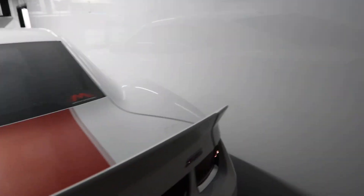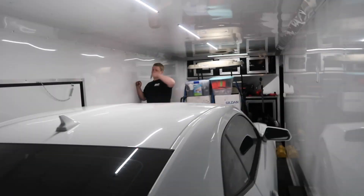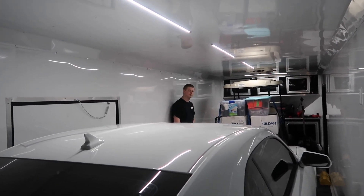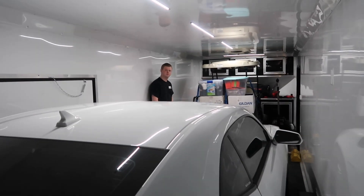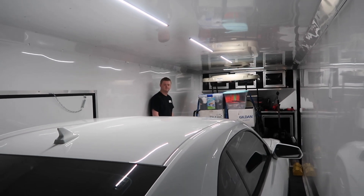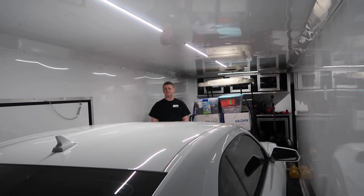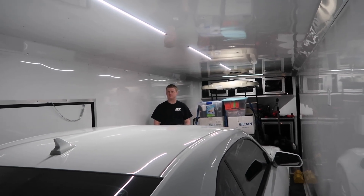What we're going to do is a little shuffling. We'd like to test this Thursday. The driveshaft shop isn't too far away and they do make great axles — not bashing them by any means. But this is a big old girl and we're trying to get it moving so fast in the 60 foot. Any slight sign of tire shake will just absolutely ruin one of these axles in like half a second. And it didn't even really shake that pass.